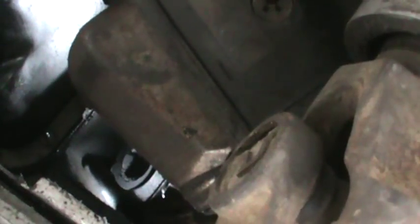And I have successfully removed the starter. There's only one step left, and that is to remove the wire and the bolt on the rear of the starter. And here's the part that I'm really happy about. Right where the I-beam suspension for the passenger side mounts to the frame, and right here where the differential and drive shaft for the front drive are, I was able to very conveniently sit the starter in place while I loosen the screws, so I do not have to have a starter dangling in the air. So now I can safely remove that wire and we can remove the old starter.